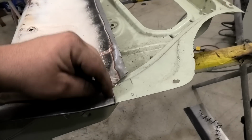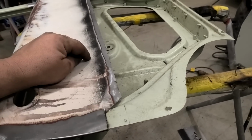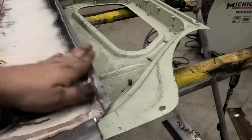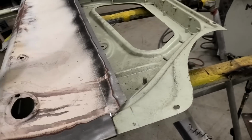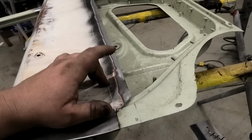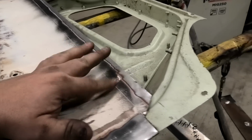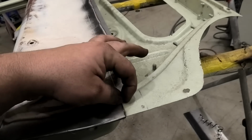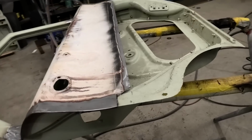So obviously this will be where a butt joint is, and if you didn't feel confident you could overlap them, but you shouldn't. Then you can just run a blade along and cut between them, and you'll get it 100%, and you'll only have the gap of the blade rather than potentially having a big wonky gap. I mean, you could cut that and probably be fine, but you do run the risk of things having moved around a little bit. This way eliminates the oh my god, I've screwed up factor. So you just cut this little bit because that's easy to rectify. It's not going to warp too badly if you have a huge gap. But along the middle, you cut that after you've got it partly tacked on.